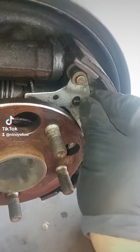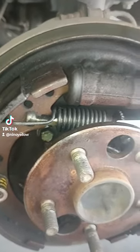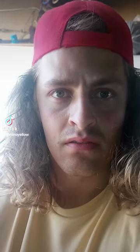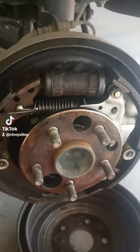Both retaining clips are there this time and I'm not seeing anything other than it just being super dirty. Everything looks good - nothing is like set in stone, you can move this stuff around, but I don't see anything falling off. In the past on these, after rain it'll just start squealing and I think I need to change brake pads, then I come look and they're not bad at all. I'll clean them up with a rag and the squeaking goes away - maybe I just need to clean them again.